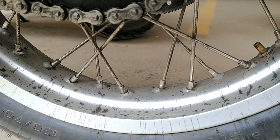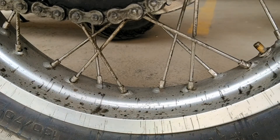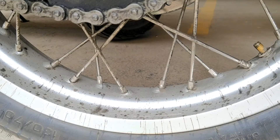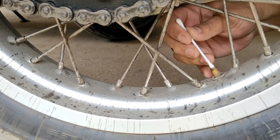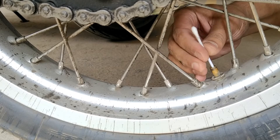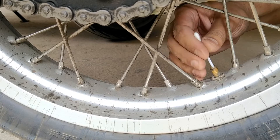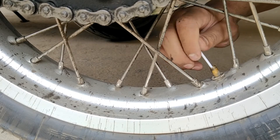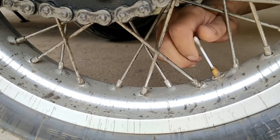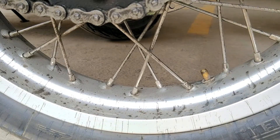Half the work is done. All you need to do is put air in the tire, but first pull out the clear pipe from the valve — don't use too much pressure as it can damage the valve. Next, use a cotton bud to remove any liquid stuck on the walls of the valve. This isn't mentioned in the guide, but I'm doing it so the valve pin sits on the threads correctly. Don't use too much pressure — you don't want the cotton getting stuck inside.